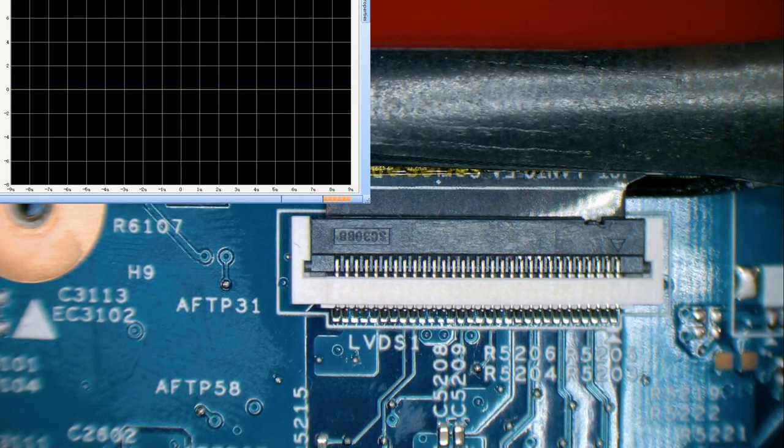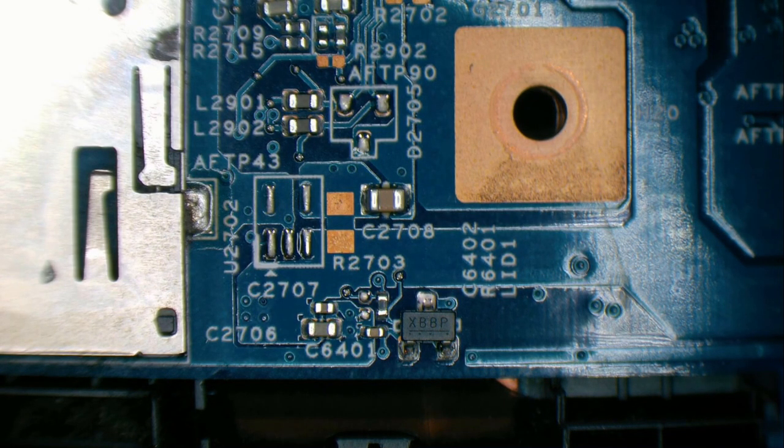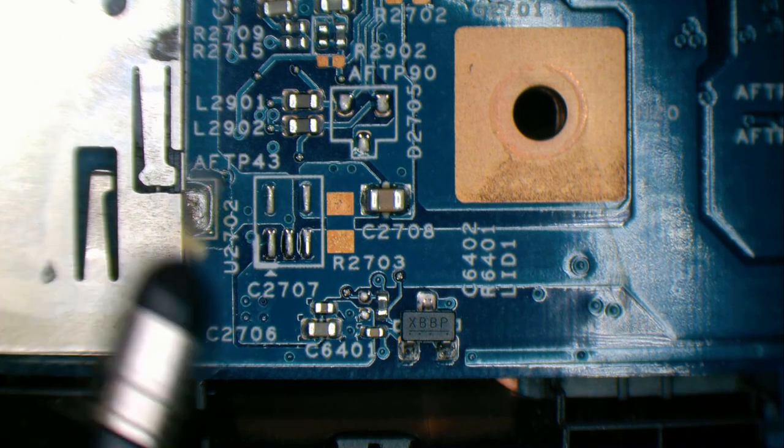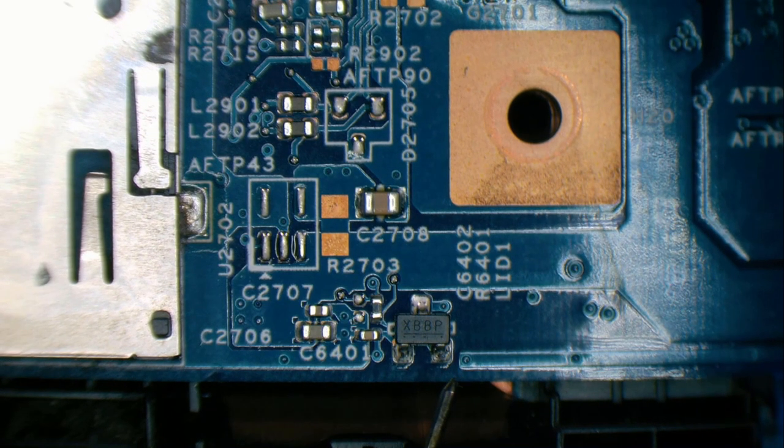But it is feeding out of the RGB port, which is interesting. So what kind of things would cause a panel to not show anything? What about the lid closed detection circuit - what if it thinks the lid's shut? Down along the front edge there's often a Hall effect sensor, because there's a magnet in the lid. As the lid closes it sits over the top of this sensor in close proximity, detecting the presence of the magnet and changing a signal to tell the system the lid's shut.